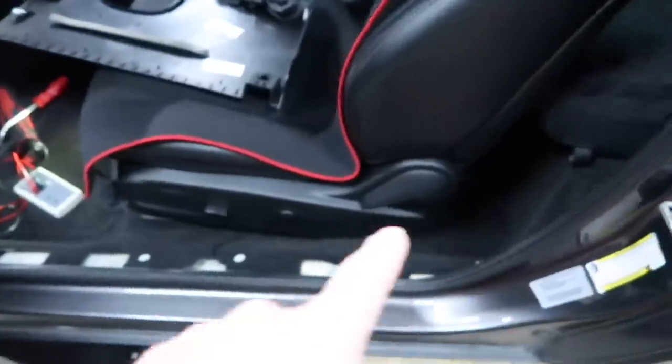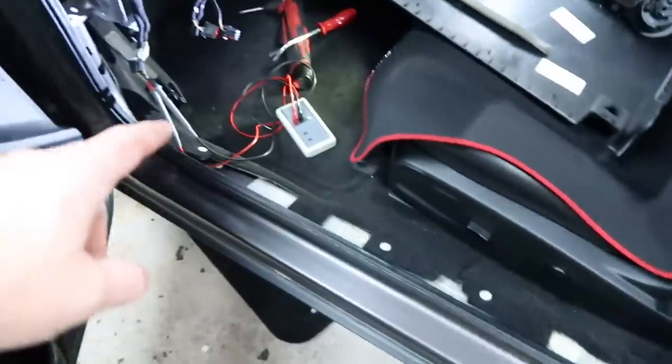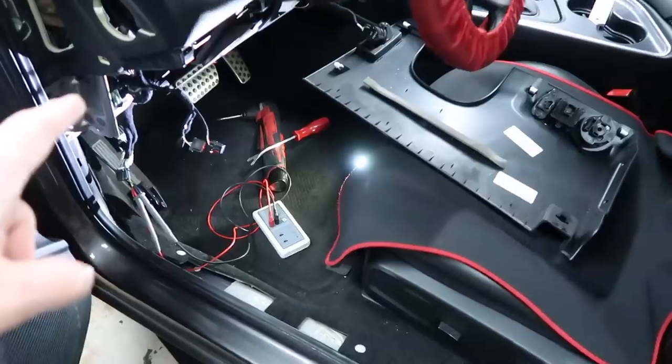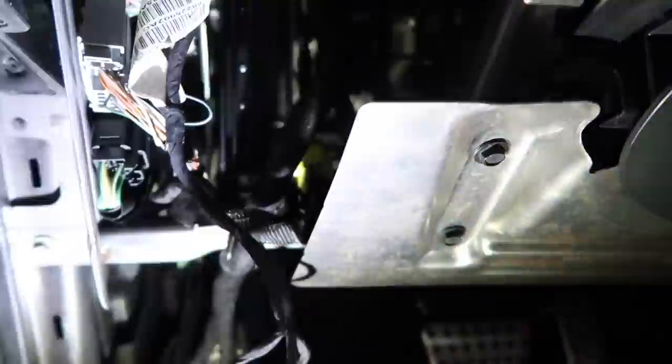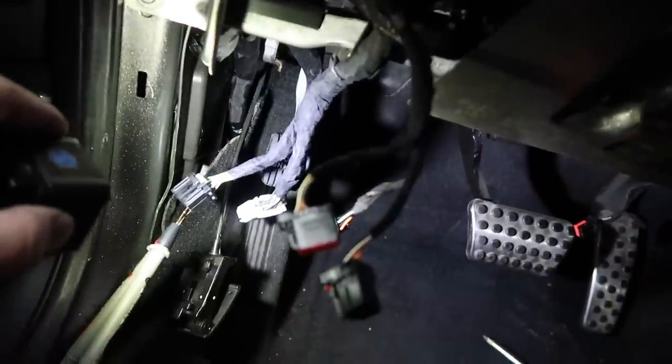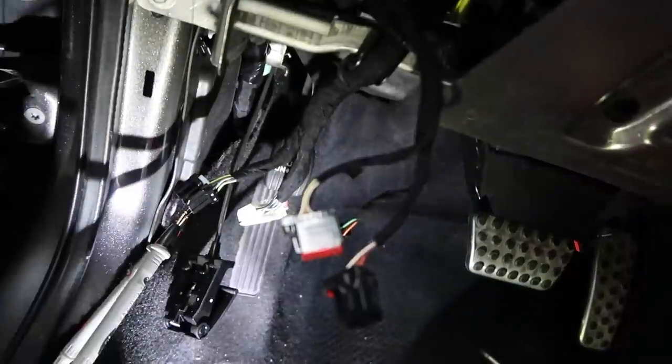So what we've done is removed this whole side of the car and the back panel so we have a clear shot for the high-level to low-level feed as well as the bass knob. Because this has the Alpine system, it has a factory amplifier located right here — black heatsink-looking thing. Down at the bottom are the two harnesses. So we're going to use the TP9A because we want to do a combination tone generation and polarity test.